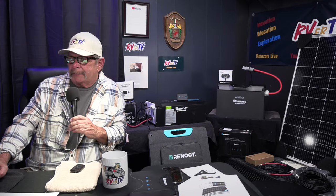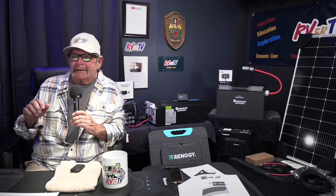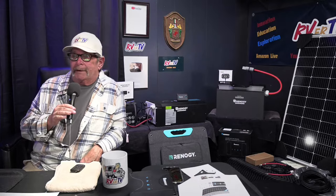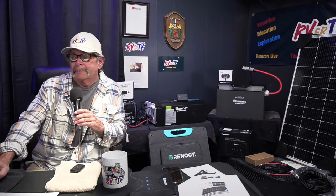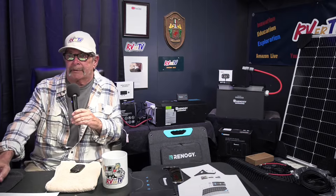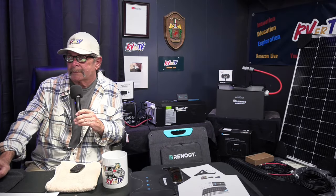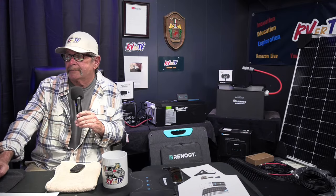Hobotech Tom says he just bought that new compact 2000 watt Renogy inverter for his RV. 2,000 watts — see, that's perfect. 3,000 is a lot, but I'm living in the van and I like to have plenty. Like an electric skillet or a hair dryer — you plug in a hair dryer and that thing's going to pull like 1,500 watts. A microwave pulls 700 up to 1,500 watts. Most inverters have a peak on them too, so if it's rated 3,000 you can peak at 5,000 or even 7,000 watts — it'll handle it without popping off. Tom just got a Class C, which is similar to the van.